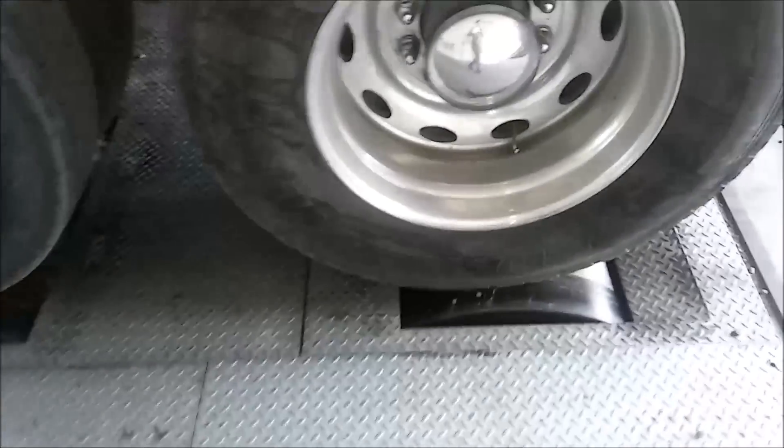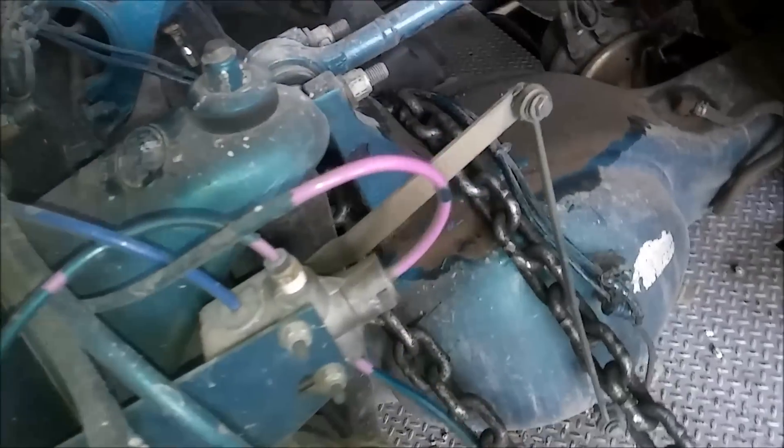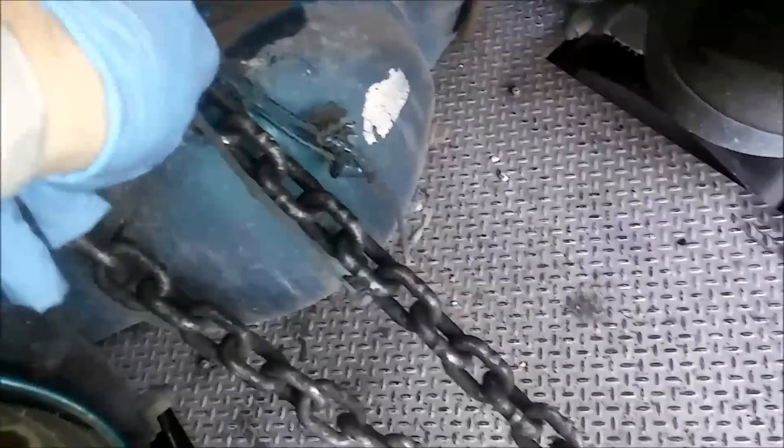Here are the two rear rollers. Both tires are set off the ground on these rollers. You also have to strap the rear so it doesn't move — there's a chain you run from this anchor point and then to the diff. Just make sure it's not interfering with the air leveling valve or hitting anything else.